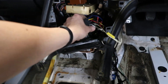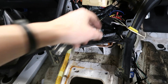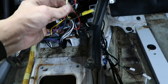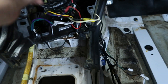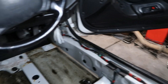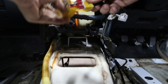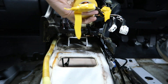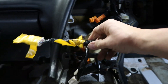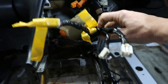So we've pulled out a lot of this center console here - the stereo, the climate control, the clock. And as always, people splicing in wires. Wires not going anywhere. Wires with bad connections. Wires just left hanging. That one's just sitting loose. And out you go. So that's our audio harness. I've just chopped it off. I've taped it up so it's not going to earth out on anything. I can now just tuck it away safely and worry about audio at another time.